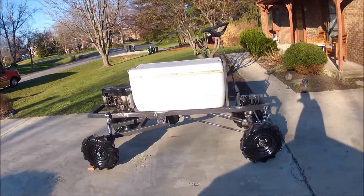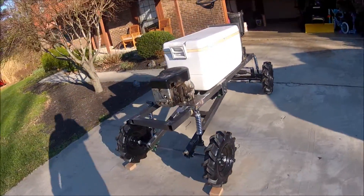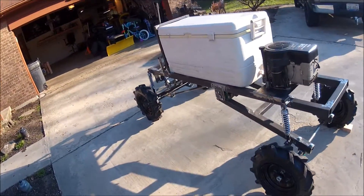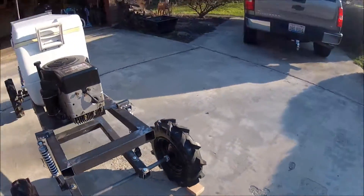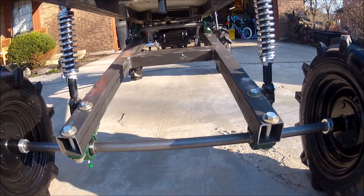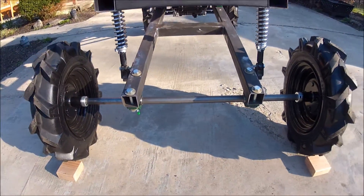She's finally sitting on all fours all by herself — no supports, has four tires under it, and just about ready to go, finally. So here's the swing arm that I finally finished the fabrication on. It's basically in an H pattern with a little bit of an angle where it's skinnier in the front and a little bit wider here in the rear.